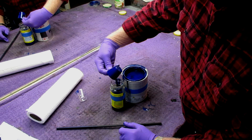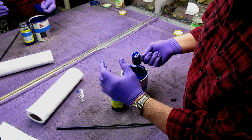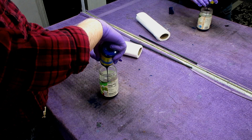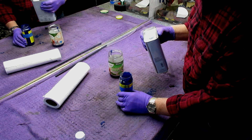Rather than just pouring and not getting it exact, I want to get an exact amount — right up to the level. This is overkill, but I want this as accurate as possible for the test to make sure I haven't jury-rigged it. With too much thinner it's going to tend to melt the plastic; not enough thinner, I'm not going to get a bond. I really want to keep it as accurate as possible right from the beginning using the thinner that Chromax supplied. I'll drain it out, then use the same jar, put the exact same amount of thinner in, mix it together, and I'll have my test batch of paint.